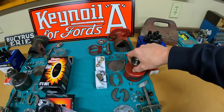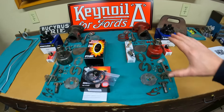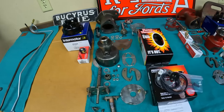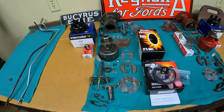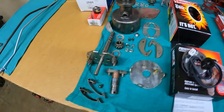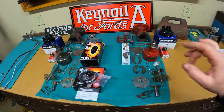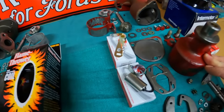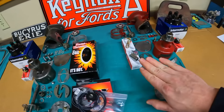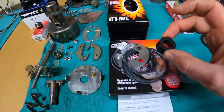At the beginning of the episode I told you we were going to be doing two distributors total. So here's the one we just took apart - distributor and drive. Here is another aftermarket Delco Remy vertical distributor and drive right here, already been completely disassembled, cleaned, and inspected. What we're going to do is build this one back up to the original points and condenser setup. This one, however, we are eliminating points and condenser and going with the electronic pickup ignition.